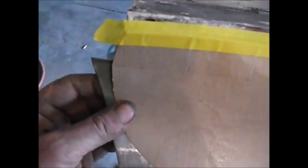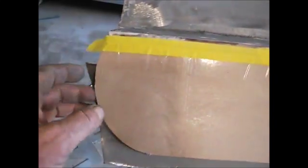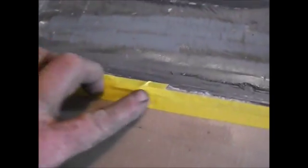Alright. Well, I got my new panel made. Yeah, it looks funny. It's got a pattern on it. Okay, just checking something out there. Now, I got my panel in there. Got it Tex screwed into place. It's all sucked up right where that flange is supposed to be. Of course, I'll weld those holes up. And the cool thing about the screws is I can take them out, put them back in. I can take that panel off, put it right back on. But what I'm doing is put my pattern on here that I made before I took anything apart, and lined it up right where it belongs underneath the little trim molding thingamajiggers that are junk and are going to come out, but they're there for, you know, good reason now.